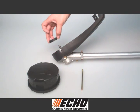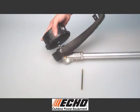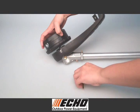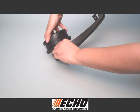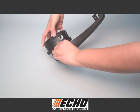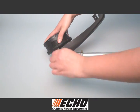Match the recess in the reversible spacer to the size of the fixing plate and install. Install speed feed head and insert the locking tool onto notch and upper plate. Rotate cutting head counterclockwise until the speed feed head is tight. Please note there should be no gap between the spacer and speed feed head after installing.